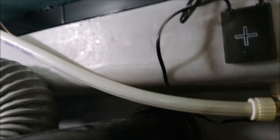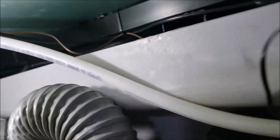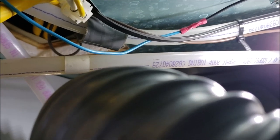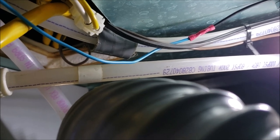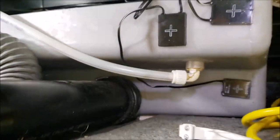While I'm under here — on this Winnebago 38J yours may look different because there used to be a metal plate that sat here. I got rid of it because it made it so much easier to get in there and see what's going on. I also added a light. I want to point out that little gray piece of hose I put over that line — it was rubbing across a sharp edge. I find a lot of places like that where PEX lines run across sharp edges and aren't really protected well, so that's just to keep any future leaks at bay.